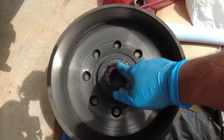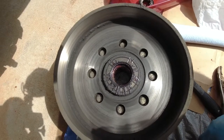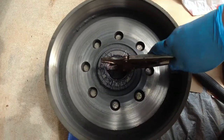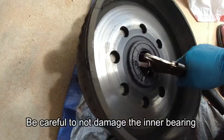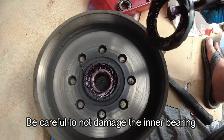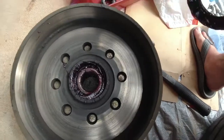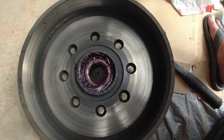But this, we're gonna remove this seal that's on the inside of the drum, and then we'll be able to pull that bearing out. So you can buy a seal puller. I will put a link in the description below. I take my pliers, and if I can work those under there, I can typically pop that seal loose, and it comes out relatively easy. Good thing is there's a lot of good grease in there, so that tells me that that back bearing has not gotten overheated, even though there's been a leak in that seal.